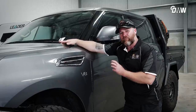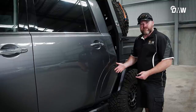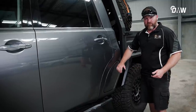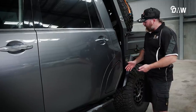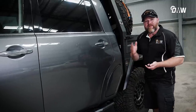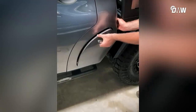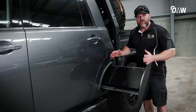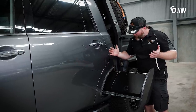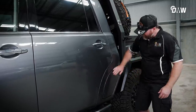When we were chopping this car, we found there was a big massive cavity behind where the wheel arches go, and instead of wasting that space we thought, what could we do with it? That's how we came up with the idea of these slide-out drawers. I didn't want a handle on the front, so we got back to the drawing board and came up with an electric actuator. We ended up coupling that to the locking system of the car so no one can break into it. You press the button and pull it out — what a great use for that space. It looks amazing and it's so functional, just a really cool finish.